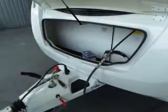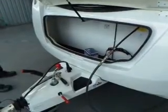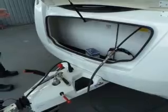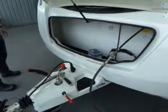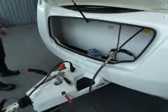Okay. So you're happy with the gas now. You've got a regulator there, which you can use either butane or propane on. It's just a different gas tail you would be required for either, because it's a different fitting on top of the cylinders. Right, round the side.